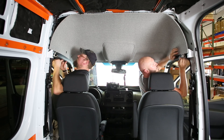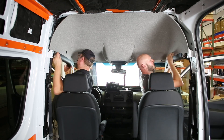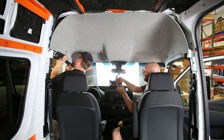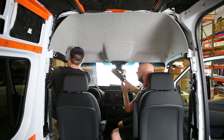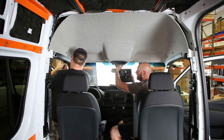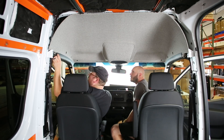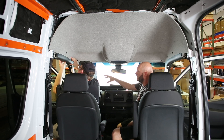Got the front one, go towards the back — you can see down here the headliner is seating nicely in that tray. Now I've got my rear one hooked so the right side's in. Nathan's working on the left side. The factory light unit is really simple to put back in — there are two little guides on the rear and they have tracks on the back sides, so you'll just set them in that track, push towards the rear, and then push the front up until it clicks. And that's installed — very simple. Nathan's got his left side in, so now we will move around and show you how to attach the A-pillar covers and the visors.